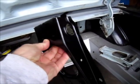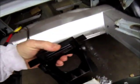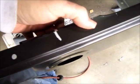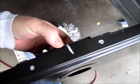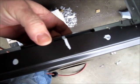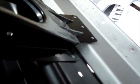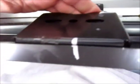this support and brace, which is used for the trunk latch. I've already kind of located it, and you can see I marked some holes. And one little tip for you here: whenever you do something like this, just draw a line where your match is, and that way you just come right back to it, put it in place, clamp it, and you're ready to go. We'll be drilling a couple holes down there, 3 holes there, and 2 holes there, and that'll get this in place.